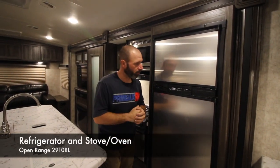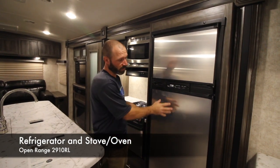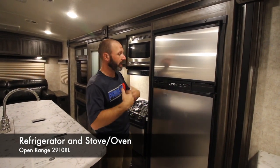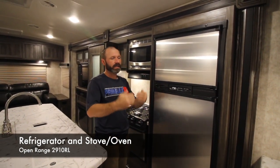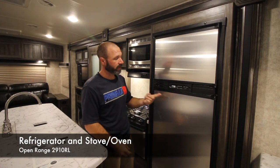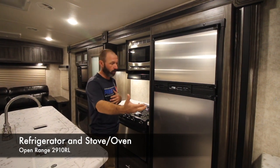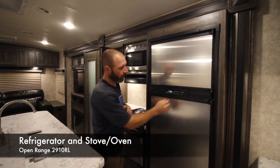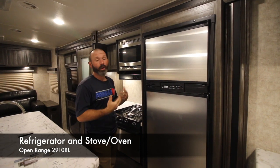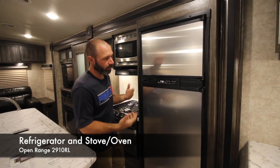Here at the icebox, first thing you want to do when you get to your spot is put a propane bottle on — you always want a bottle on whether you're cooking or not, because the fridge uses it. You have auto, gas, and off settings. On auto, if you're plugged in and electricity turns off while you're away, it will automatically switch to gas to keep everything cold; when electricity comes back it switches back. In the middle is off, and on gas you're running on just propane — good for long trips or no electricity. On the end is your temperature control.